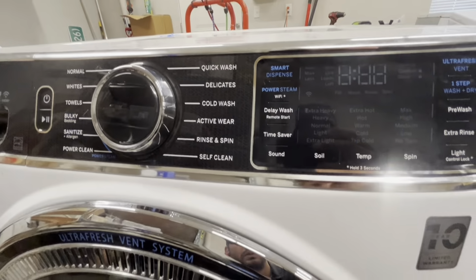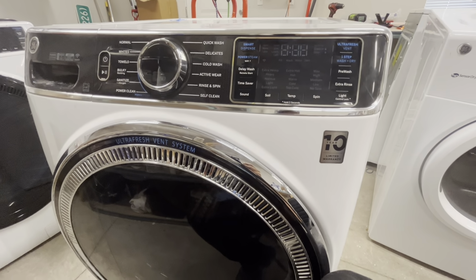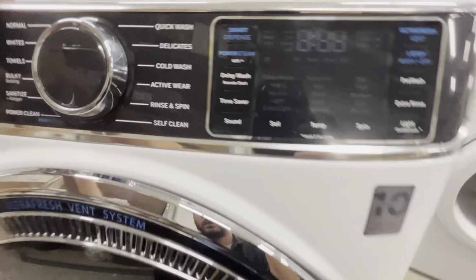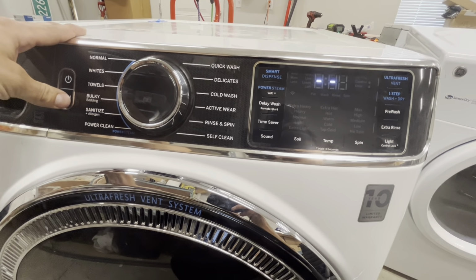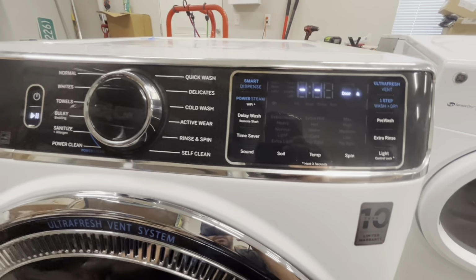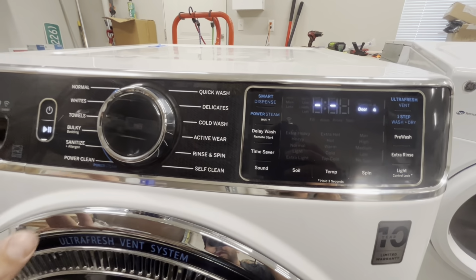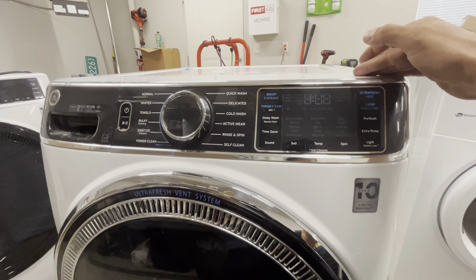So with those lights on, we can now view the error codes, and they'll flash like this, and then you scroll through. So we have error code 3, press the play again, we have error code 27, and that's it. So if you look at the error codes, the only one significant is number 3. Now press any key on the display and you can exit that.